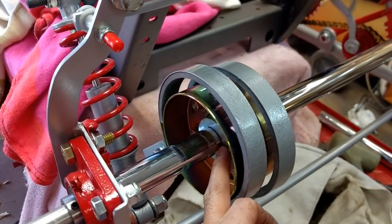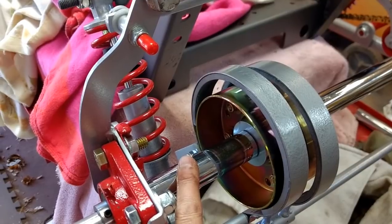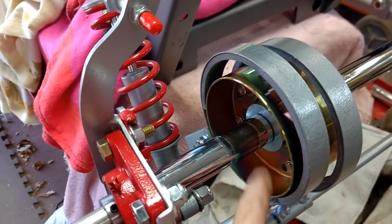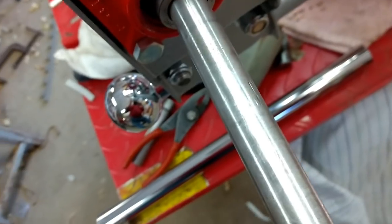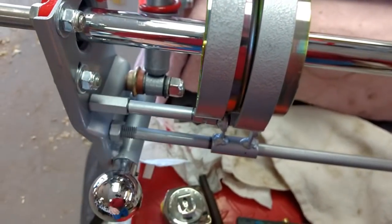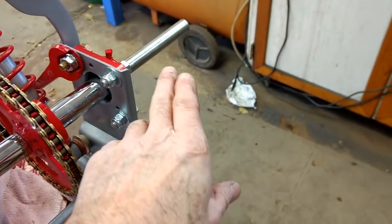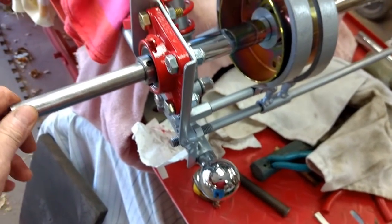I had to stop the axle flush on this side of the hub and get the pipe plus the tubing on top of it lined up. I also had to make sure that groove on the pipe was lined up with the key slot. It's a snug fit, so I actually had to pry it into place and finally had to have my wife come out, because I couldn't keep it lined up and swing my dead blow hammer on the other end. Between the two of us we finally got it all the way through.